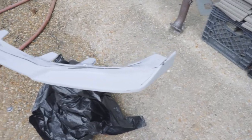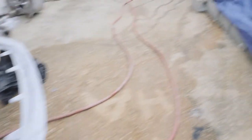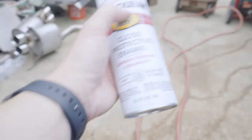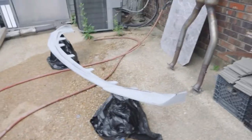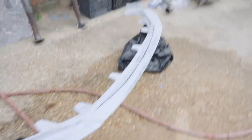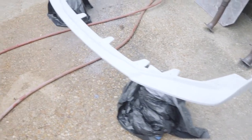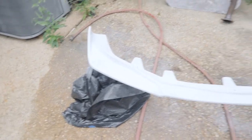This is how it looks right now — a lot of bald spots. I got my brother's opinion and he said it's fine. My base coat will be the Rustoleum gloss protective enamel. Again, this is my spare lip — it just needs to look good enough for daily driving. I hate seeing my car lipless, so this is just a lip to drive around and break. I do have a show lip that's already professionally painted, so this is my canvas to practice on. For the first base coat I'll let it dry light. I sprayed the ground with water to absorb any overspray — it's pretty nice. Going to give it about 15 minutes to dry.